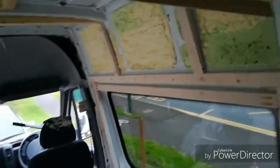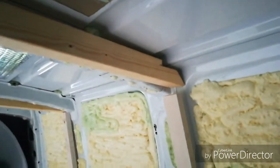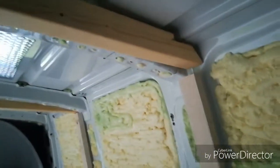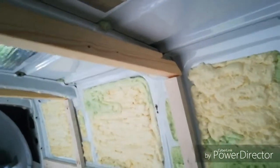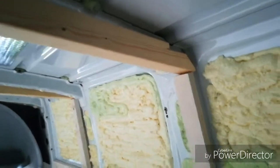I've been doing a bit of messing about, a bit of thinking. I was going to cut each piece of timber and sit them in there like that, but then I'd have to deal with the curvature of the van on that metal piece when putting the ceiling on. So what I've decided to do is drop it down and lose 20-25mm of height, which isn't that bad, because Becca and I can still walk about and we've still got a few inches above our heads.